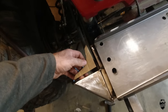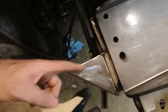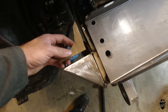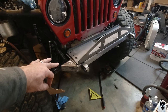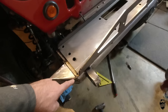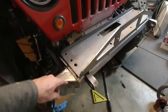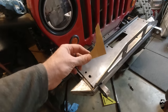So I'm going to put a plate in here — something to weld in so it's not just a square that looks kind of weird. I'm going to make some plates for each side, tack weld them in, then bolt the whole bumper down to the frame fully, tighten everything, and put some really big beads on the main portions. Probably not weld the whole thing, but big beads on the main parts. When I take it off and fully weld the inside and other parts, it won't move around on me and my bolt holes won't shift. So let's cut out some brackets.